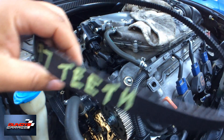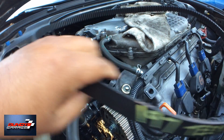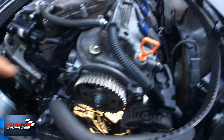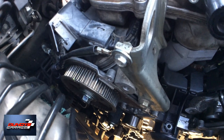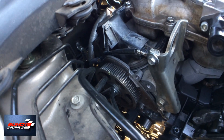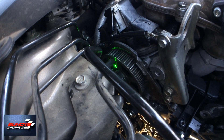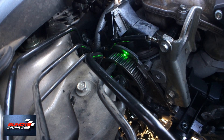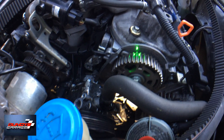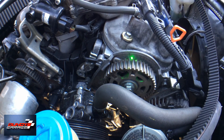The first thing I did was make sure this was the right belt, so I counted all the teeth — 197 teeth on this belt. I lined up the front cam, which is right here, and I lined up the rear cam, which is right there. I made a mark right where the laser is at, and you follow that all the way back to the wall where there's another mark that lines up. There's a mark on the cam there as well, and they line up.